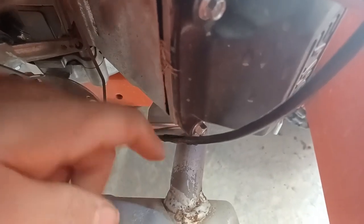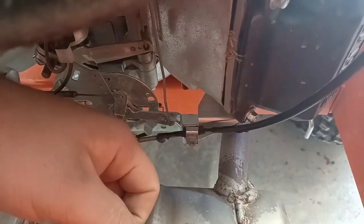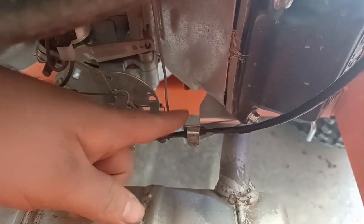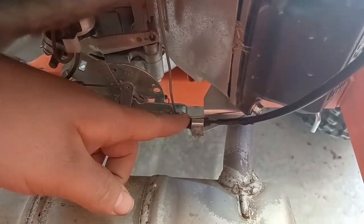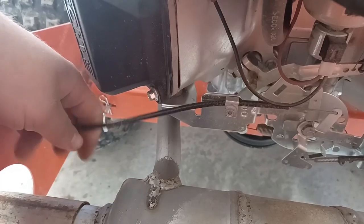This was some poor routing because this cable is actually touching up against the valve cover bolt, which allowed this line to heat up. So what are we going to do to fix this, and more importantly, what can you do to prevent this? This is also common with the choke cable, even though I've yet to have any melting on it yet.